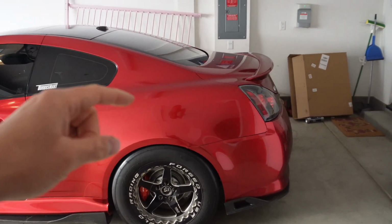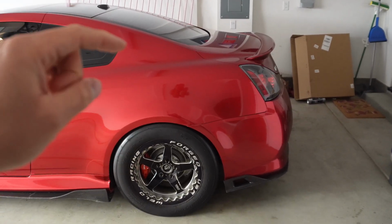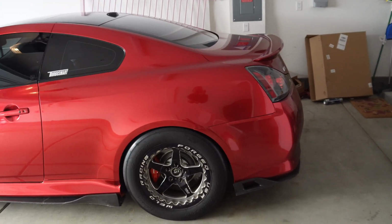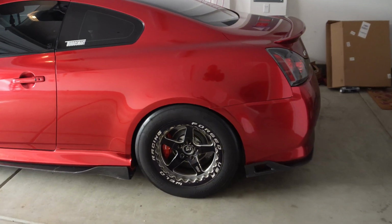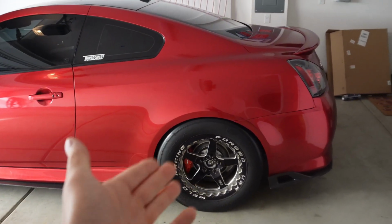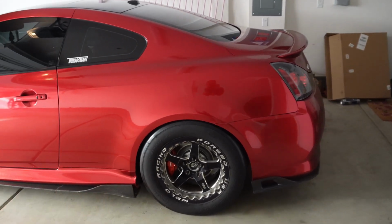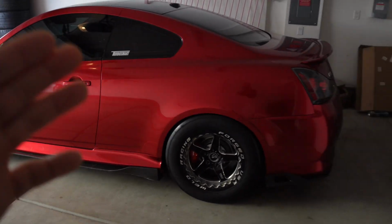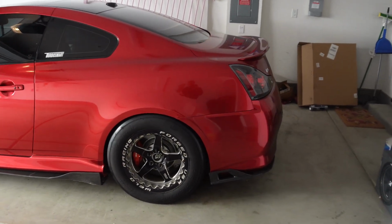So we are going to be swapping out my differential with a longer gear differential. So we're dropping the differential. I'm trying to find something a lot smaller, because like I said, right now the IPLs from factory come with a 3.69. I'm going lower. I'm going much lower. And it should help with us not spinning on 50 rolls and 60 rolls and stuff like that.